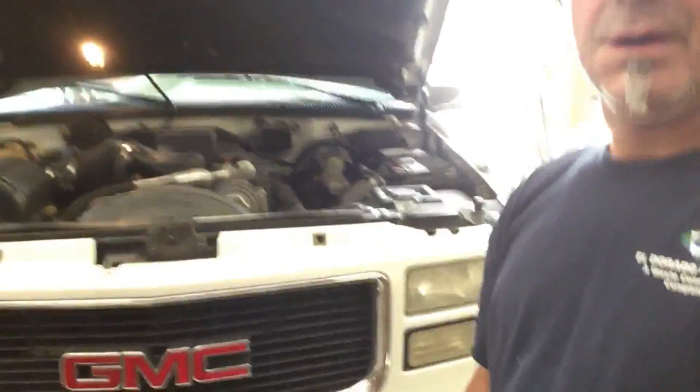Hey, it's Saturday morning. Today we're going to work on my 1996 GMC Suburban. It's got an oil leak — actually probably more than one, but one that's really made it unmanageable. I've determined that most of it is coming from the oil cooler adapter, which is mounted on the engine block where the oil filter would normally go on a small block 350. This is a Vortec 350, but underneath all that fancy plastic it's pretty much a Chevy 350. I'm doing this with the iPhone, so it's not going to be a real detailed video — I'll need both hands. But I'll give you as much information as I can, including all the part numbers, so you could do this yourself.